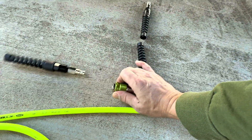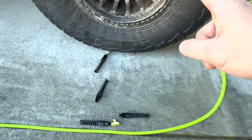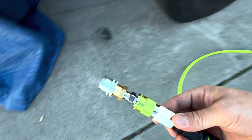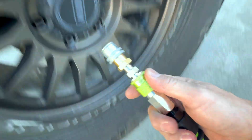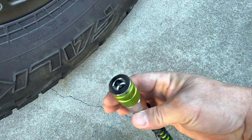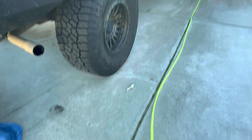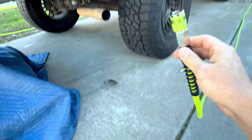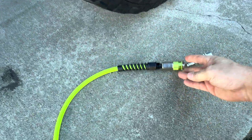We created a little attachment point here, just like the other driver tire. What's really cool about this side — what I'm excited about — is we have a different fitting on the end here and this just goes straight in there. But if you had a power tool, you just pop this off and now you've got an air hose. This hose is long enough to reach all around my truck, so I'm going to be able to use the pneumatics to get the wheels off or any type of roadside repair. It should save a lot of time, and it's fun.